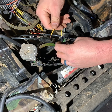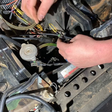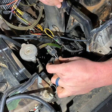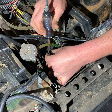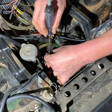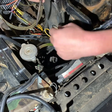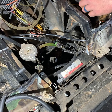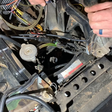I've got a little piece of wire and I'm going to jump between these leads, because it's just a contact that tells it when to cut on and off. I heard the relay click. So now I'm going to go to my fan. Right here is the fan lead that sends power to the fan, and I'm going to check the leads on the fan — and I have no voltage. So there is no voltage getting to my fan at all. That tells me I either have a blown fuse, which I have not checked yet, or I have a bad relay. I hear the relay clicking on and off, so the relay is working, but it may not be making good enough contact to be sending voltage to the fan.